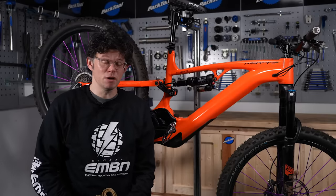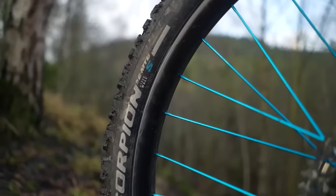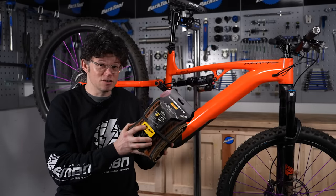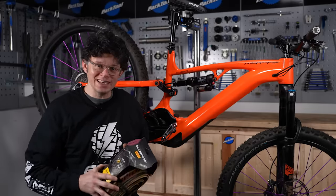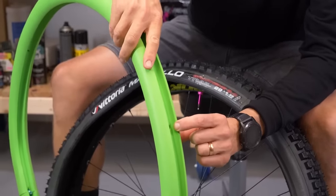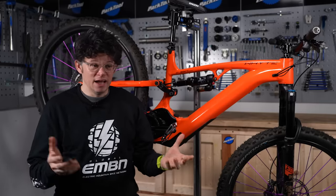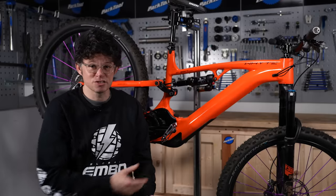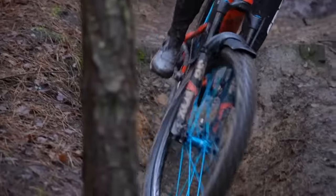There are dedicated e-bike tyres for a reason. There are subtleties in tread that make them a little bit better and grippier, but the big news is in the carcass — they're much stiffer, much stronger, and can stand up to the extra weight of an e-bike. Stiffer sidewalls also mean you're less likely to dent rims or punch a hole in your tyre. On the subject of inserts: you can get lots of different ones and they don't have to cost the earth — a Vittoria Airliner can be found for under £40, which is half the price of a tyre and a lot cheaper than a wheel rebuild. Running an insert on the rear is a great idea to save the tyre, save the wheel, and give you the option to ride home on a flat.